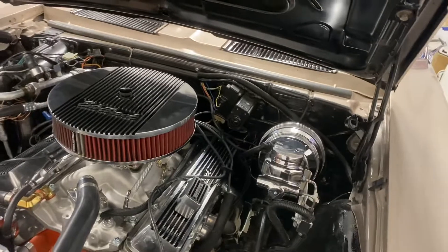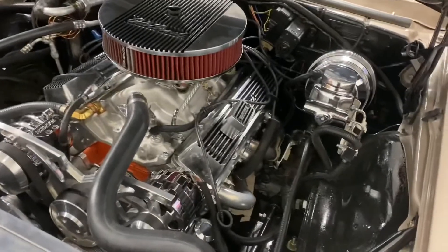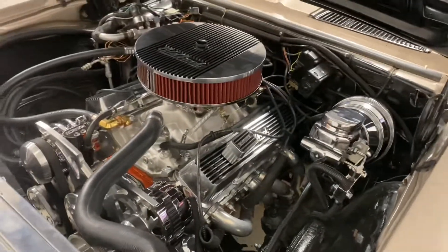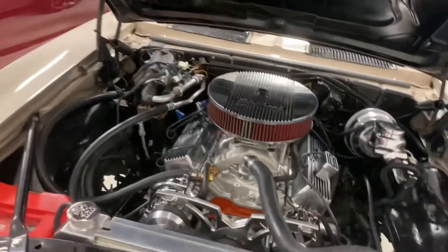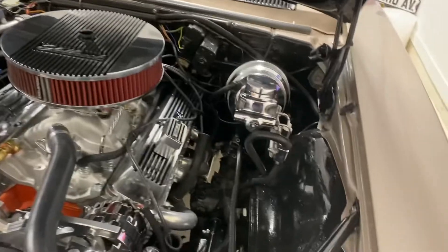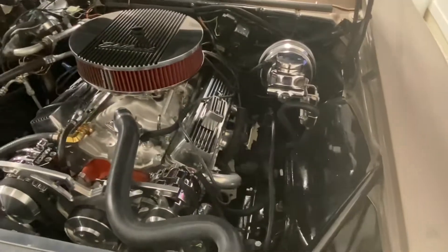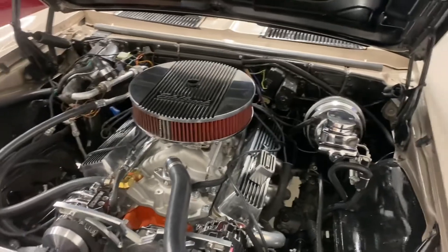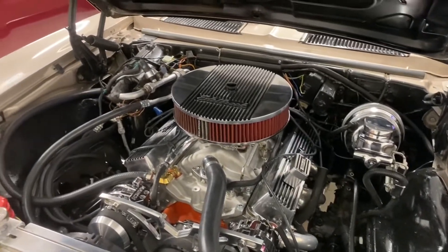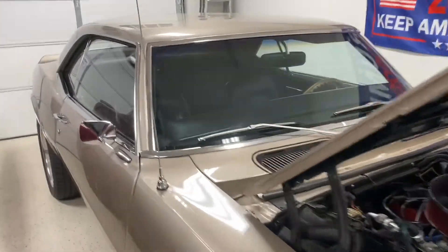Also putting on a new power steering pump — it's from March and they gave me the part number for it. The old one just wouldn't turn right going slow. I thought I'd got all the air out but it just wasn't right. This one's working fine. Tried to beat the headers away from the steering box a little more — there is a gap there now, no more contact, and they're ceramic-coated headers so it won't put too much heat to it.